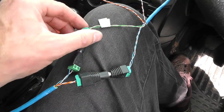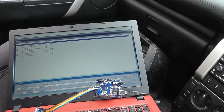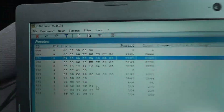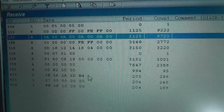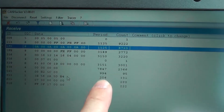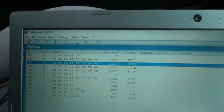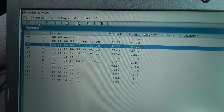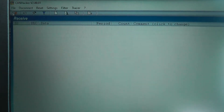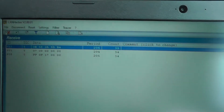So what I'm going to do now is disconnect the rest of the car from the dash, so that all we're getting is going to the laptop. That's it broken. As you can see, some of those are still turning over — it's basically just the last three we're still getting, and the rest have all stopped. After refreshing: all we're getting is 3 CAN bus signals coming from the dash. That's all we're getting.